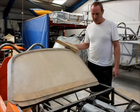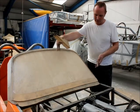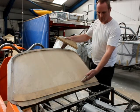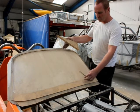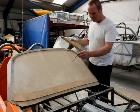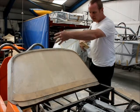Can you tell us about the windscreen? The first thing to do is choose a windscreen that would fit the job. In this case we're looking for a particular curve — the chord depth as they call it. We then get the width correct and, within reason, the height correct. We want to make sure the driver's vision is not impinged, and we determine the rake angle of the screen. Once we've got the piece of glass, we make the pattern for the windscreen frame. This is made of flex plywood, which is very flexible and enables us to get that curve.